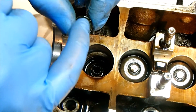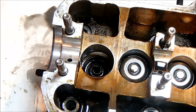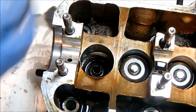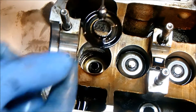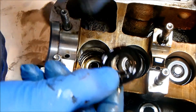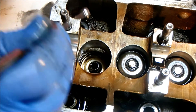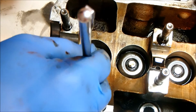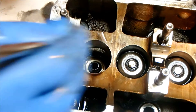There's a little bit of sooting around the top of these, so perhaps there's a little bit of blow-by, and there's some crap on the inside as well — a good opportunity to change those. Is that the final piece of the puzzle? I think we're down to aluminium now, so I think that was the last piece to come out.